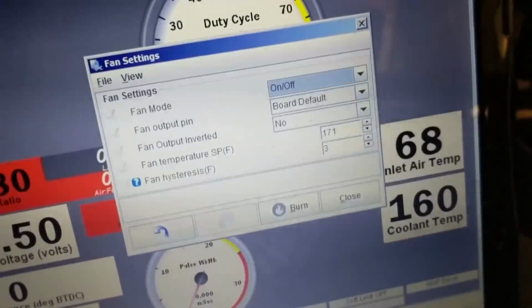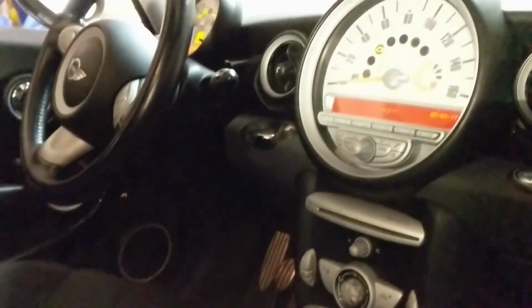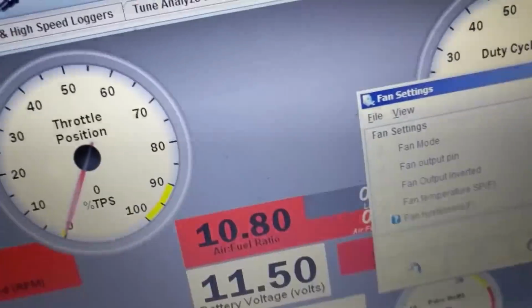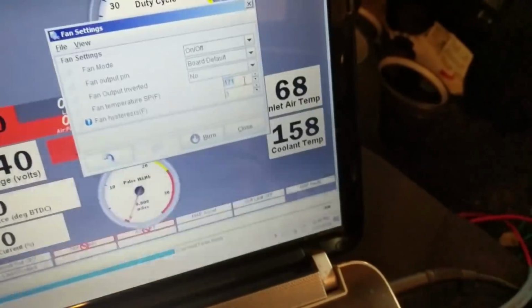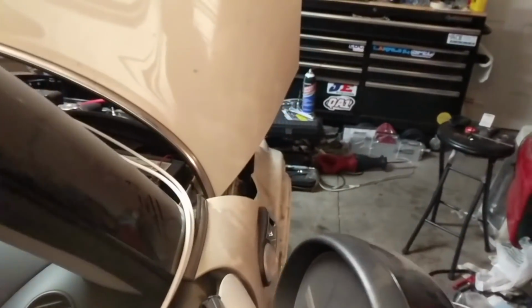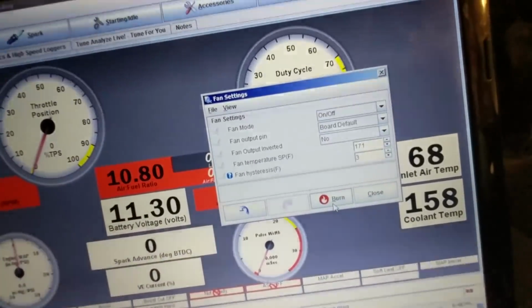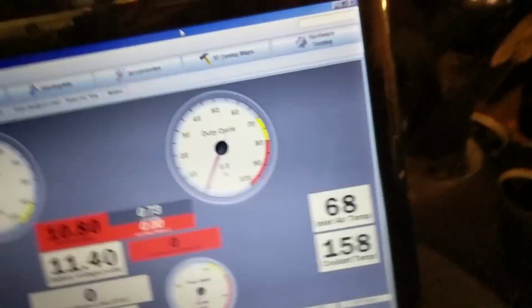So to check what we got here, currently the coolant temp's 160, the engine is off, but the car key is on, so this should work. We can test it right now. If we turn the car off, the thing should ground if it's always got power. So it doesn't always have power, which is good. Then we can turn on the car. Now we do 155, let's say, since that's below the coolant temp. And our fans just kicked on, if you can hear it. We can come back here and say 171, and our fans turn off. So that's working now, so we got that set up, and we'll just have to finalize the wiring for it, and then that's it.